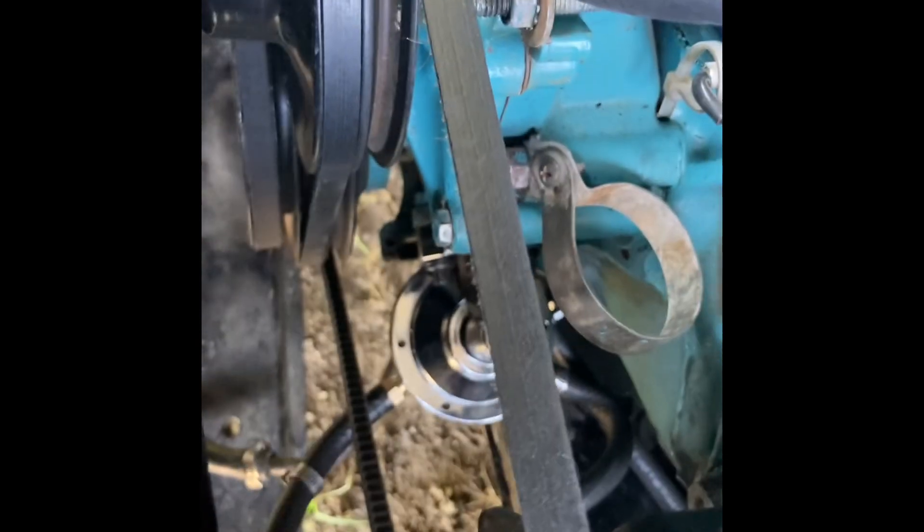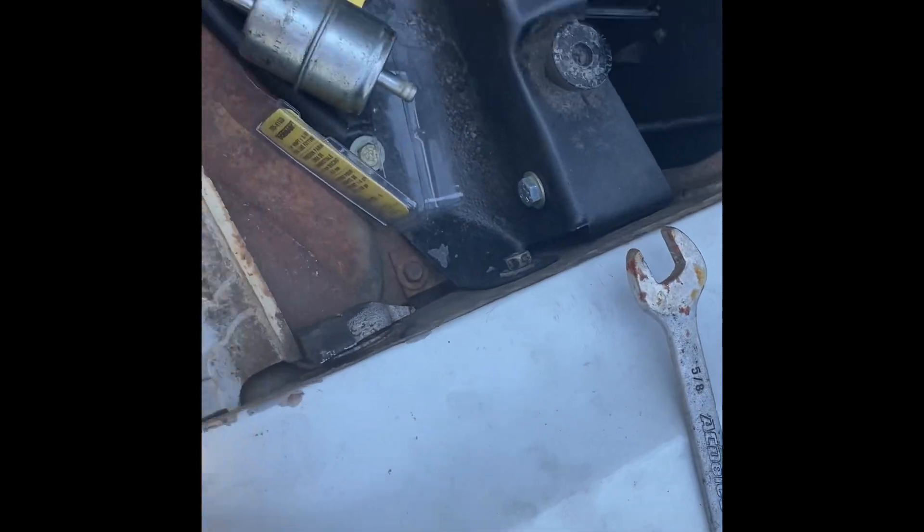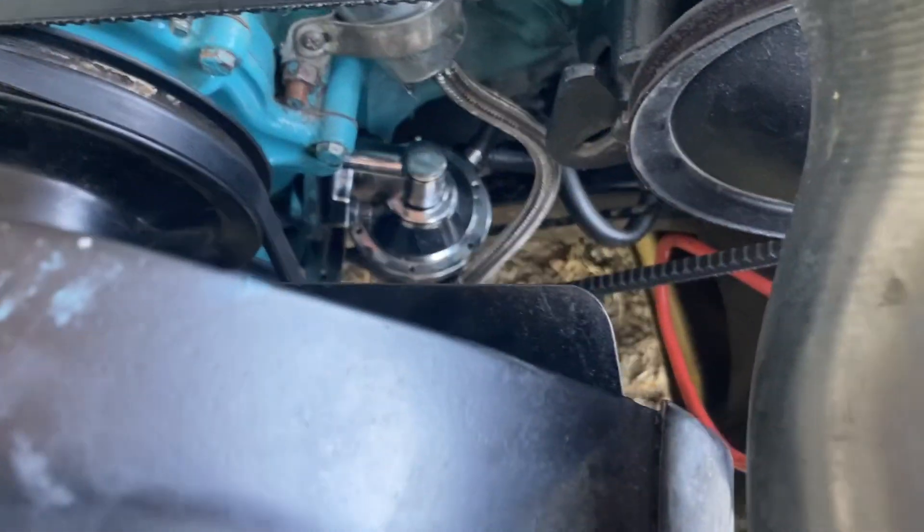I noticed the fuel line is very close to the belt — I didn't see it until I put the fuel line on. I took the fitting out of the factory pump and swapped them out. I went ahead and cut some new steel-braided fuel line and got the elbow on there for now. If it leaks, I'll put a plug in it and swap to this filter. I'm going to go ahead and crank it up, make sure there are no leaks.